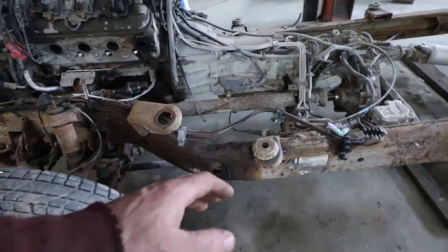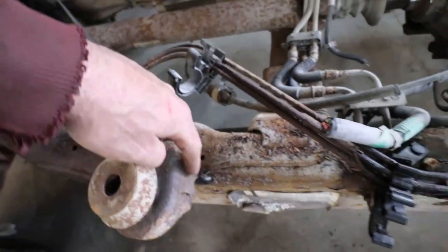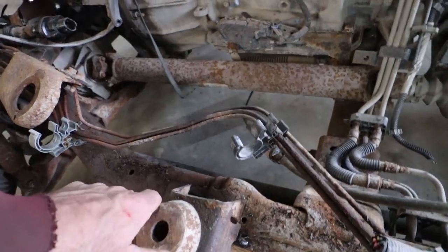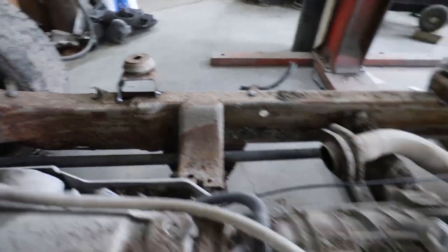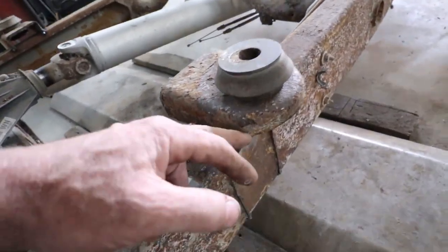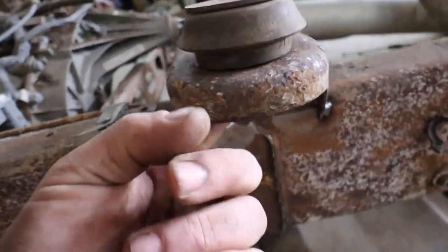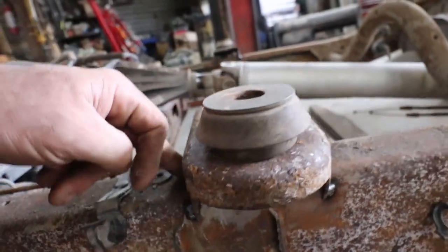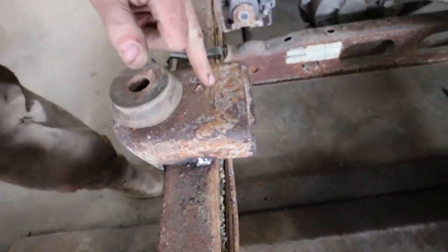So I'm definitely not happy the way these ones came out, because you can see they don't sit on the frame very much. It's not a lot of meat, and they don't side saddle the frame very much. Same with this side. It's kind of cruddy. These, on the other hand, you don't even need much side mount because these bolts are just sneaking by the frame. So I have to clean this up, but I'll burn these in. I'll be able to cut these and taper them off at a better angle.